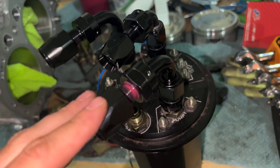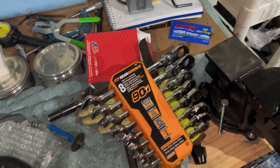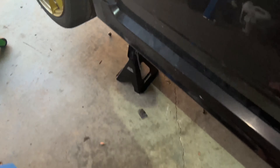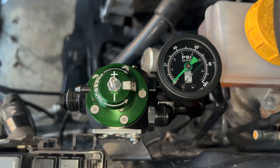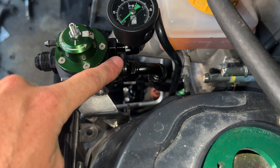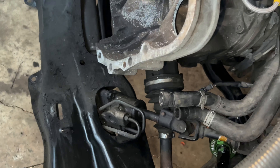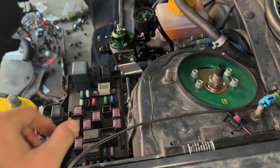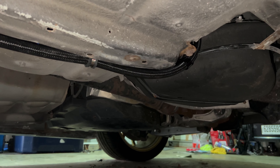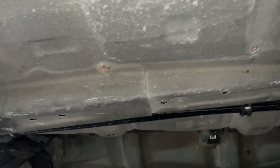As you can see, I got these guys mocked up here — brand new wrenches, so excited for these. And clamps. Look at that. She's pretty much all set up. Just need to work these little lines from the FPR to the ethanol sensor and then to the fuel filter for the feed line. Return line is set up. I'm pretty much in, and then I just knocked out this guy — she is in there, all bolted up and everything.